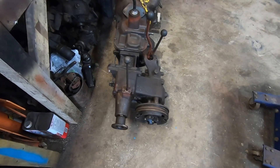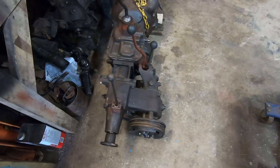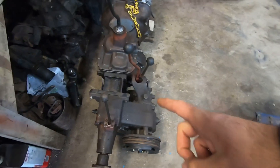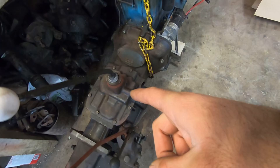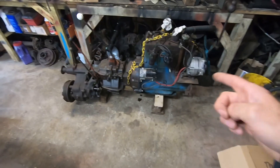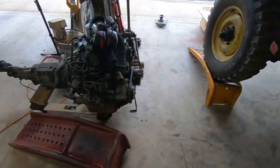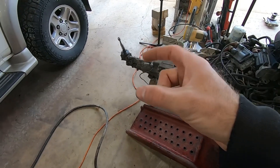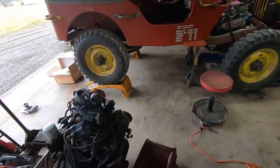Here's a quick view of the drivetrain I took out. Even though it's a four-cylinder with a truck transmission, it's still extremely long — that's why my rear driveshaft was so short. You're going from the back of the transfer case: you have the transfer case, then since I'm running an SM420 I have this adapter which is almost six inches, then about a foot-long transmission, bell housing, and the engine. This engine is about seven inches longer than the rotary, so I'm over 60 inches from the crank pulley to the rear output with the original setup. While the rotary with the five-speed is long, it's coming out very close — with the coupler shaft I need for the transmission, I'm around 63 inches. But I am sliding the whole drivetrain forward, so it's all going to work out.